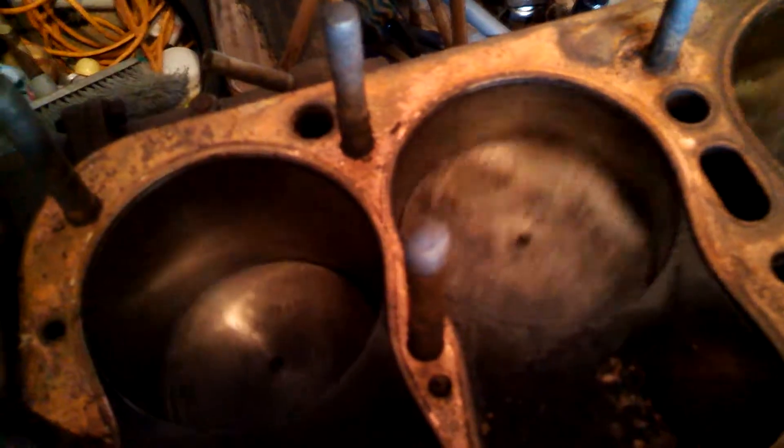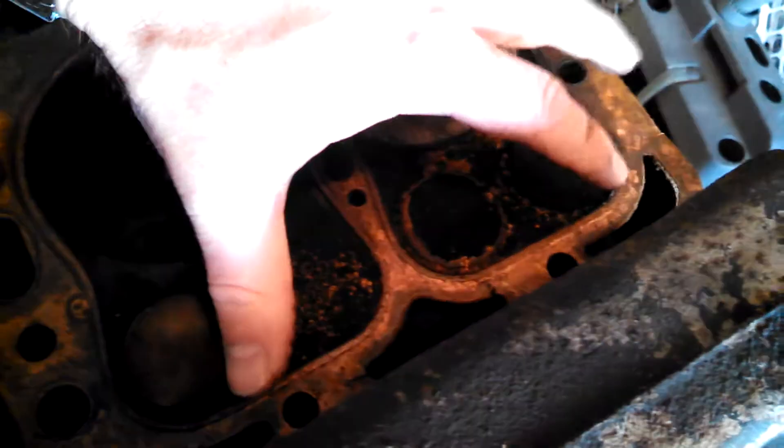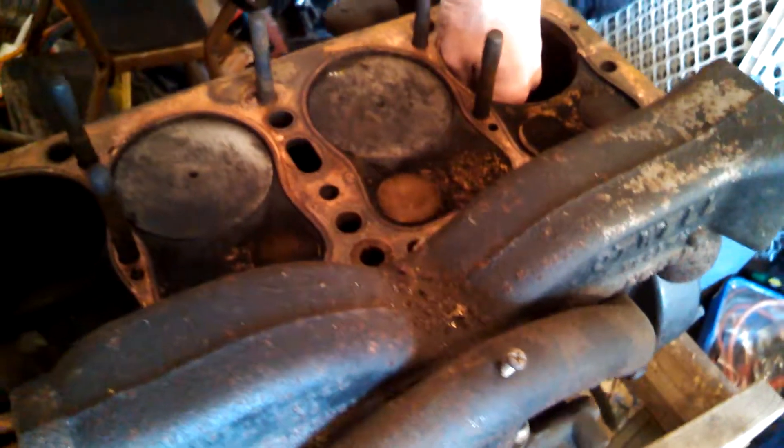So here's what's going on inside the engine. Are these pistons? These are pistons. They're huge. In some things they are smaller. Now watch over here — this is a valve. So this is all sealed up, right? And when this piston goes down, it's like sucking air. So the only way air can come in is through the valve. See it coming up? So the air's coming in through the carburetor, picking up some gasoline, shooting up, coming in here, and getting sucked in. All the way at the bottom — it's called bottom dead center. It starts as far down as it goes.